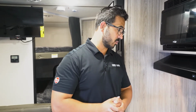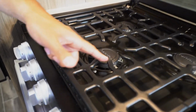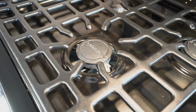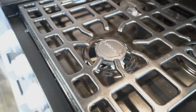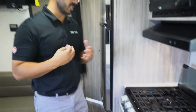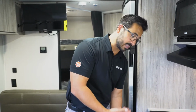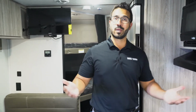And so what I would do for a quick reset is turn off the propane for about 10 minutes, then slowly turn it back on, and that should reset that regulator so that way you are getting nice even propane flow into the camper. If it's still not lighting, or maybe 2 of the burners are lighting, but one of them isn't, well, then you're going to want to check the burner assembly itself. Make sure that your sparker isn't all jammed up or gummed up. Same thing with the burner and the burner tube. Just make sure everything is cleaned off because that can, again, affect the ability of it to light. So that's going to be kind of your basic troubleshooting tips. Again, for safety, folks, please remember, not a heat source. Leave the oven open and make sure that it lights correctly before you shut that oven door, and you'll be a master chef in no time.